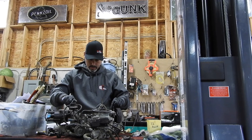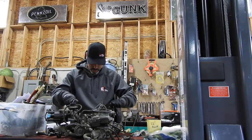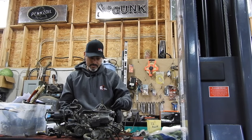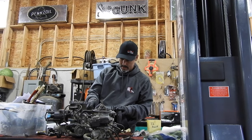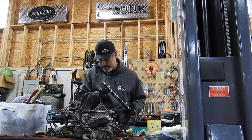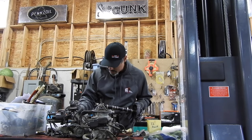I've cracked all the camshaft bolts loose and they're coming out nicely — got a bit of crud on some. The valve cover was one of the hardest I've ever taken off; the seal just disintegrated in my hand, but it was holding on like grim death. We got it off. I can see the timing — it can only go one of two ways with the teeth, so we've got to be careful not to spin it.